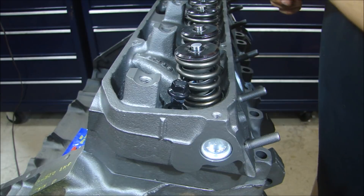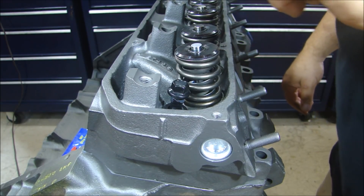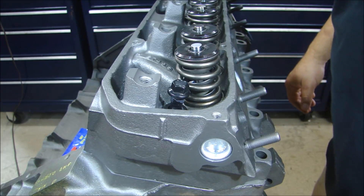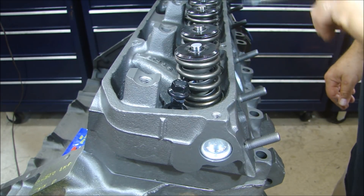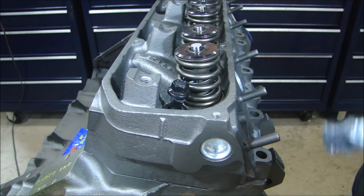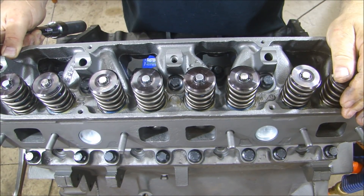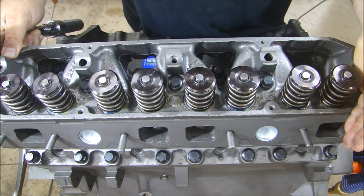There are 17 head bolts, so I've got to do all 17. Now when you have 17 bolts, it's good to follow a sequence — the torque pattern. Like I said, follow manufacturer's recommendations. The bolt pattern for this is easy. I remember that the outside bolts are always an even number, so it goes 1 through 17 in sequence, just like that, and I'll do it in 3 equal steps, all the way up to 70 foot-pounds.